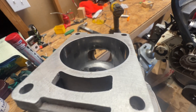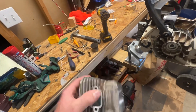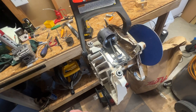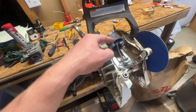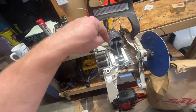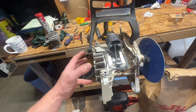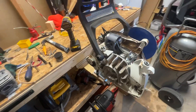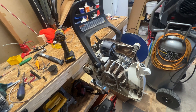Here's the intake port. I need to fill the intake with some JB Weld — it's currently sitting at 90 degrees, as I took more material off the skirt of this piston to run the stuffer. I felt it was okay to do that because I can just fill the bottom of the intake port with epoxy and save myself the difficulty of grinding in the case — getting metal shavings down in there. The design allowed me to do it a different way, so that's what I'm going to do.